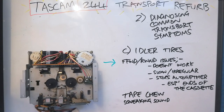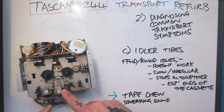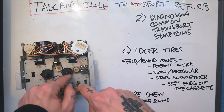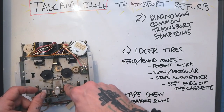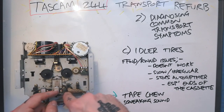One of the main giveaways that you've got problems with your idler tires is going to be problems with fast forward or rewind. It might be that they don't work at all, or they work but they're slow or irregular — you can physically see the reels getting slower and then speeding up, or stopping altogether even though it's not the end of the tape. One of the biggest problems is that the transport starts chewing tape. If your idler wheels are slipping against the take-up reel, it's going to end up not turning as fast as the capstan pin, tape is fed into this area faster than the reel can take it up, and it'll go around the pinch roller and get chewed up.